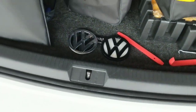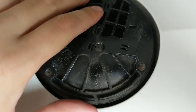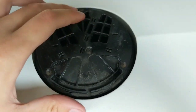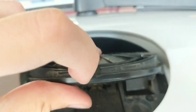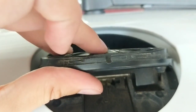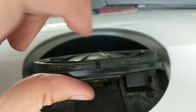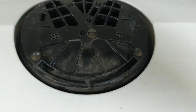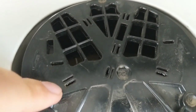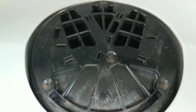Get it in between the chrome and the black once it's lifting from the vehicle and use the car as leverage. Here's what the vehicle looks like without the emblem installed. The notch I was talking about — you're going to push the emblem upwards and right in the center of the emblem you're going to see a little indent. You're going to want to put that metal pick tool in there and begin to pry the emblem up. Once you've got that in there, put the plastic tool in its place to hold the emblem up, and work your way around the outside.